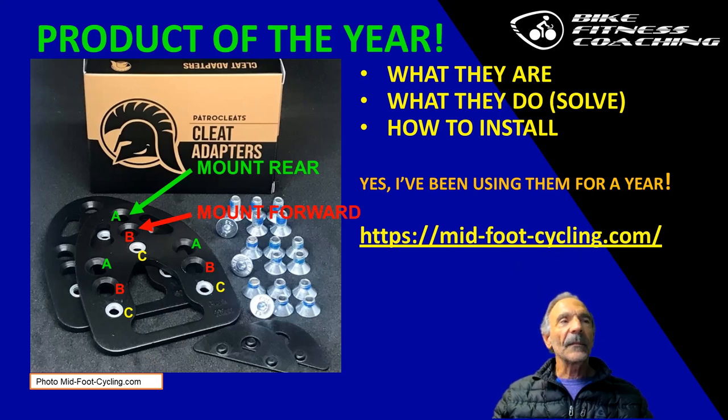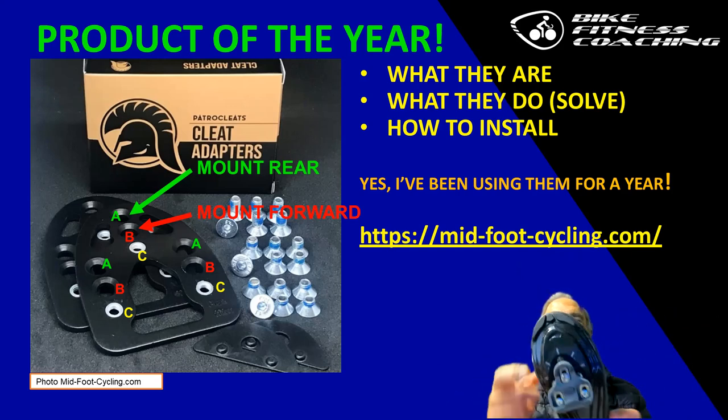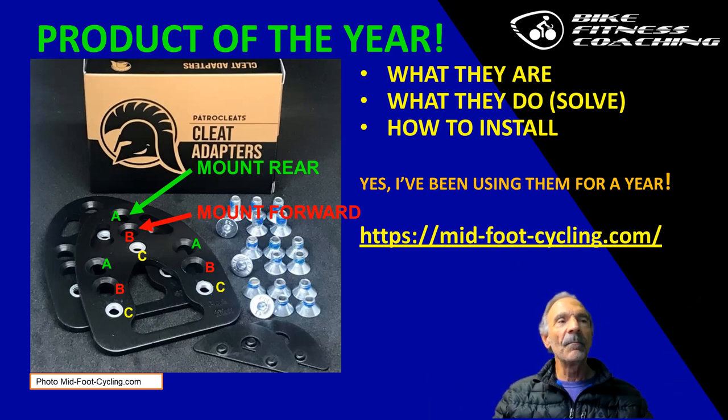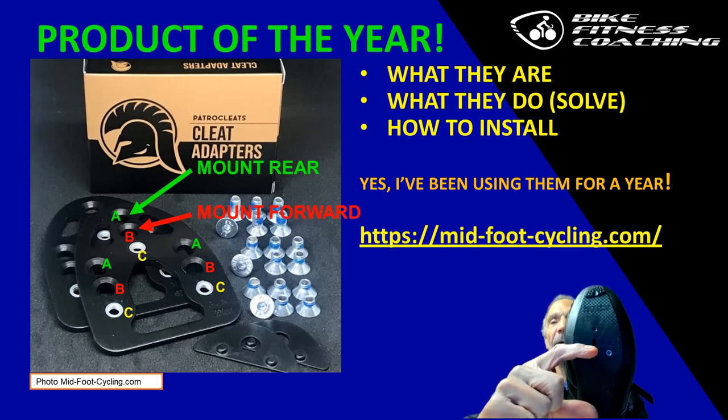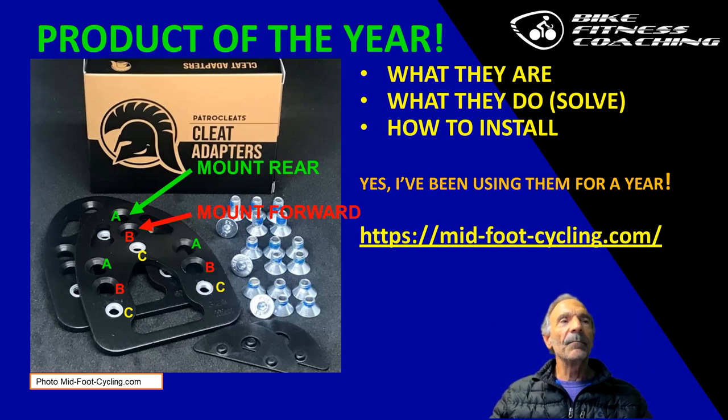The picture to the left, look at A, B, and C. C would be normally where your cleat gets mounted on the three holes, like a Look Keo or a Shimano SPD-SL, which would get mounted onto level C. If you're moving it back one position, that would be B. It's actually the forward mount for the midfoot cycling cleat adapter. A would be the rearward mount. So with B, you can imagine you're moving the cleat plate, which is the cleat adapter, slightly back, and with A, you'd be moving even further back. So now you have more adjustability, two mounts, forward and aft, to move the cleat further back.